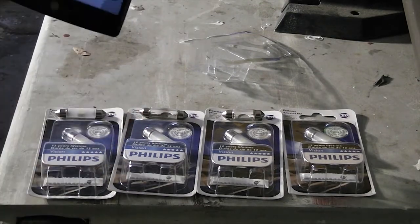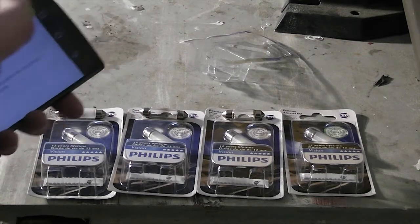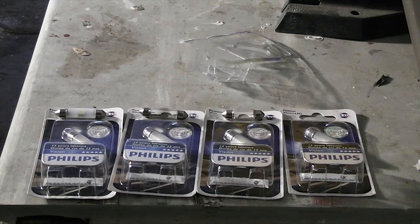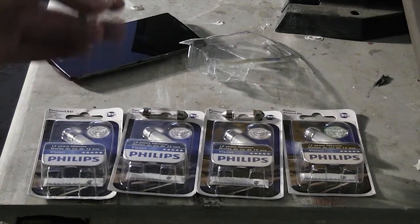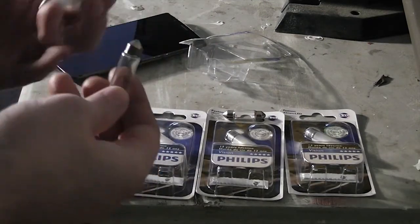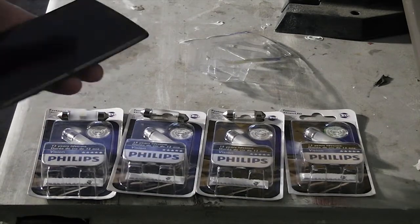The way these light sensors work is that they're calibrated to the sensitivity of the human eye, but the human eye has different sensitivities for different colors of light. We're more sensitive to yellow and red, and less sensitive to blue light. Now, these LED bulbs have a 6000K color temperature, which means they're a little bit on the blue side of the spectrum. So even if by a very accurate measurement of light output they're identical to incandescent bulbs, because they're more blue, we will perceive less light, and the light sensors on phones will reflect that.